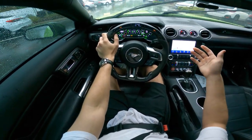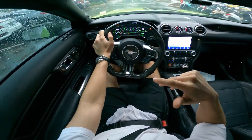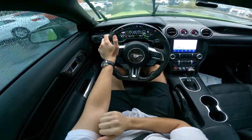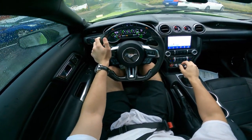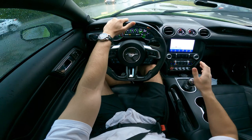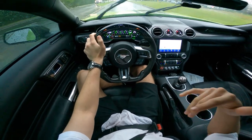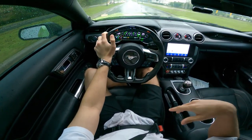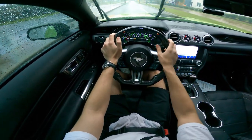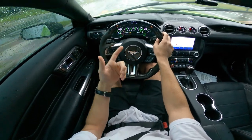Just got rolling. The very first thing I'm going to teach you is to look at the RPM that you're at at a certain speed. We're in first gear going 12 miles an hour at 1700 RPMs. Now shifting to second — cruising at 23 miles an hour, I have 2200 RPMs. You need to remember which speed you're at and which RPM you're at in each respective gear. So now in third gear, if I drop the speed down to 23 miles an hour, I need to give the car a blip to about 2200 RPMs to rev match correctly.